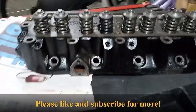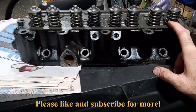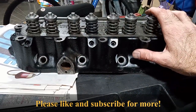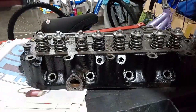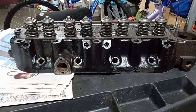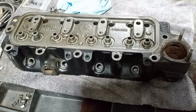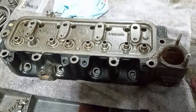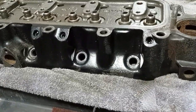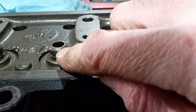Welcome back to McNamara's Garage. In this episode we're going to look at why you really do have to take your cylinder head to a machine shop if you want to do certain things to it. It's an MGB head. It kind of looks like a nice head, but I put new valve guides in there. I tried some lapping of the valves but they just made a mess of the valve seats. What we have here is the big valve head for the MGB from '71 to '72. I thought I'd be slick and get this for my '77 because it kind of needs a new head, but I found a crack in the valve guide here.